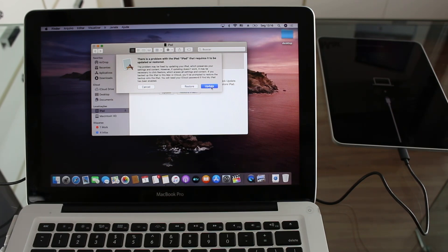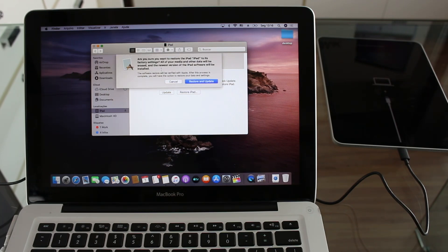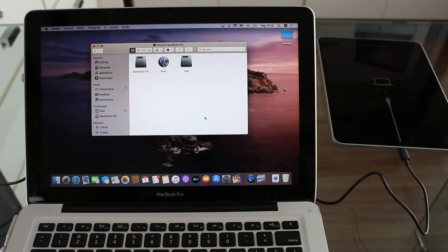What we need to do is go ahead and restore. If you go ahead and update, it will not work — we need to restore. That's why we will actually delete all the information and lose all data from our iPad. It's just confirming: are you sure you want to restore? And then it tells you it will restore and update. You may get extra screens saying you're going to download iOS 12 or iOS 13, telling you which iOS you're actually downloading. It's just extra steps. And now it will go ahead and start downloading the iOS itself.